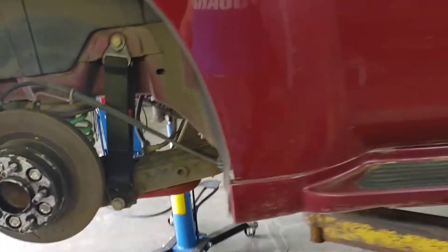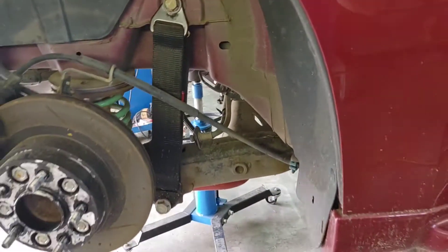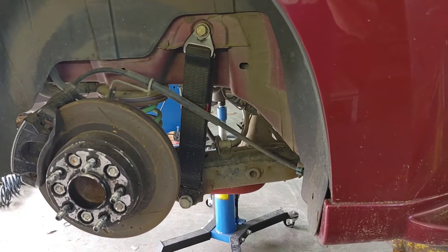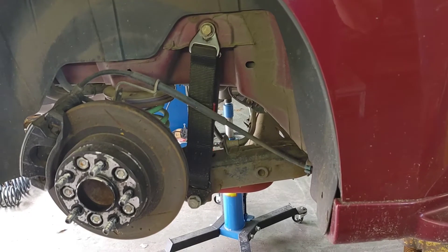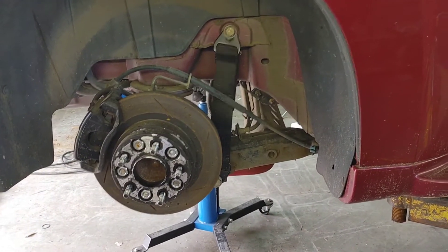To solve the shock problem in the rear, I ran my KYB shocks — they were just longer in overall compressed length than the drop shocks. I got these 13-inch limiting straps off Summit Racing for about 25 bucks. The shock company wanted 300 bucks for a pair, which is ridiculous when KYBs are far better for only about 30 bucks and I already had them. The limiting straps, about 20-25 bucks a pair, fix the issue of the spring assembly falling out every time I jack it up.